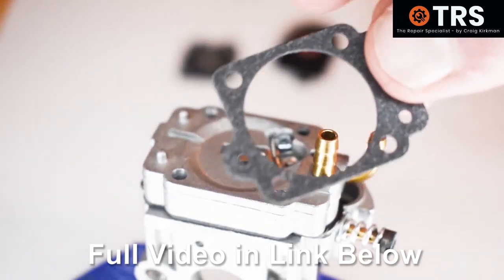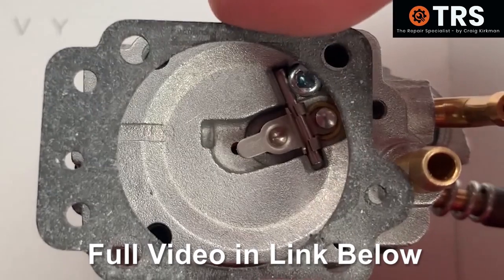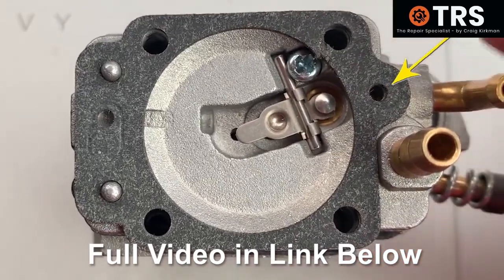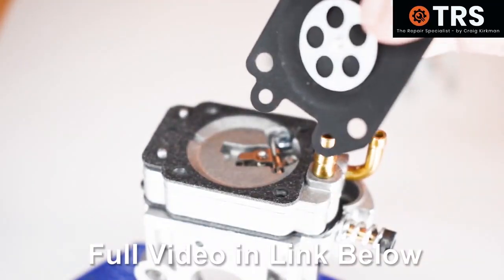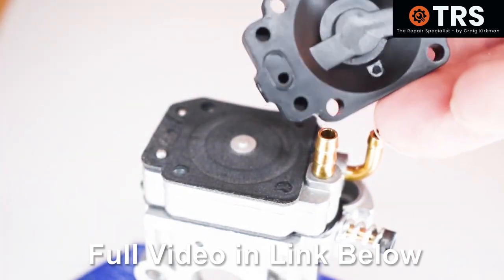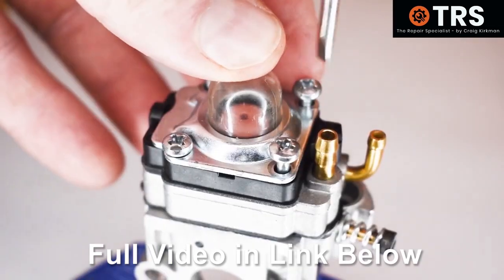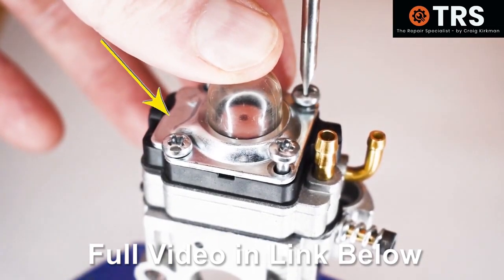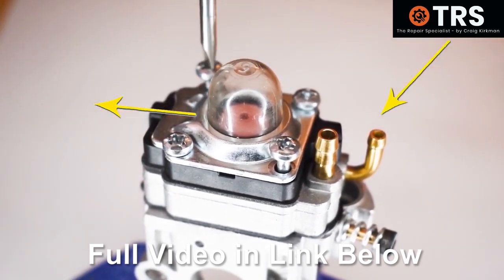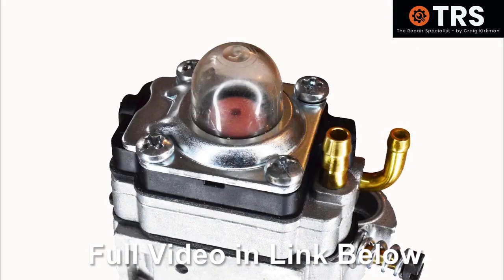In comes next the metering gasket — that's got two holes again and it sits on the raised points on the carburetor body. You couldn't get this the wrong way round because on the opposite side there's a hole which again matches a hole on the body. The metering diaphragm is just the same — the holes on the end are placed over the raised points. Then it's the same with the plastic metering cover. And then with the primer bulb sufficiently within the retainer, the retainer is placed on top with the extended part facing outwards, away from the fuel pipe's inlet and outlet. So there are probably fewer components to the primer bulb system than you might have originally thought.